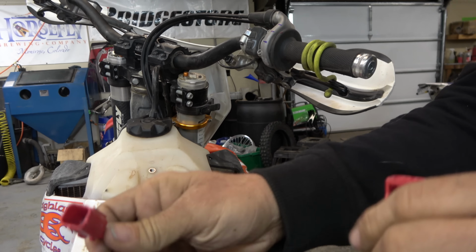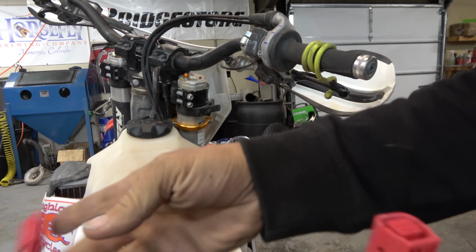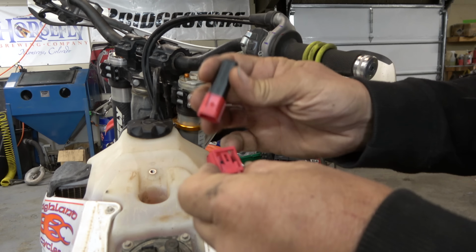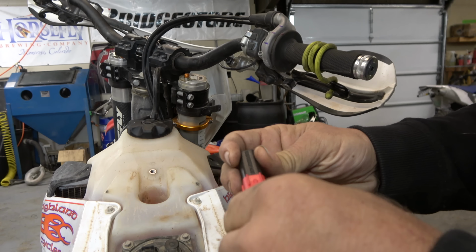All right. Now we unplug our, this is the True North wiring harness. This is the trigger wire from my light. So just unplug that, or you can unplug it from the thing down here on the seat. So you get the OBD port out. Now, supposedly, if I read the manual correctly, you're supposed to just take this dongle and we're gonna plug it in. We should see some lights flash when we do. Let's see what happens.